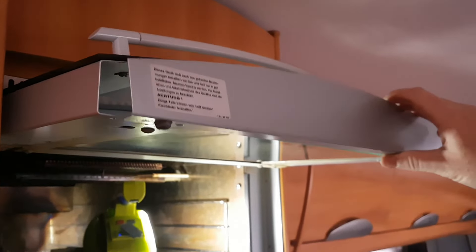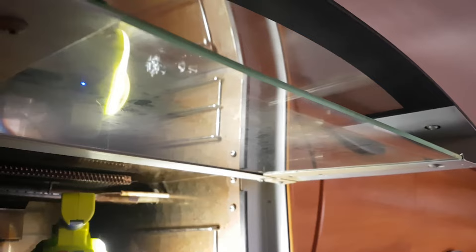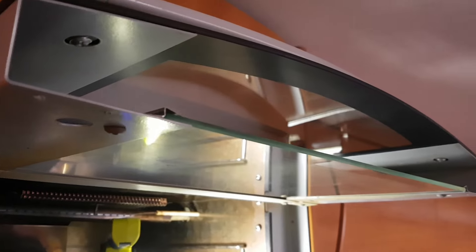Then with the aid of more self-tappers we have this kind of end panel which sits on here and is held in place by more self-tappers. The hinges — everything's loose right now. All the bolts holding the hinge to the glass clamp are loose. The Torx bolts here holding the hinge lug are loose too — it's kind of a cheesy fit and finish. Once it's all in and seems okay, I'm going to start clamping things down very slowly. It's going together okay — touch wood. Let me put a few more self-tappers in and see if I can get it all clamped down, and then we'll see if the hinges work without snapping.